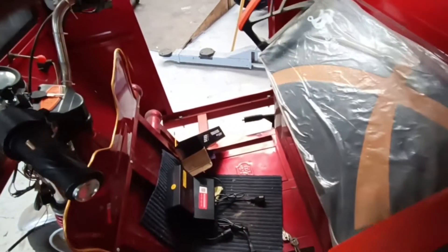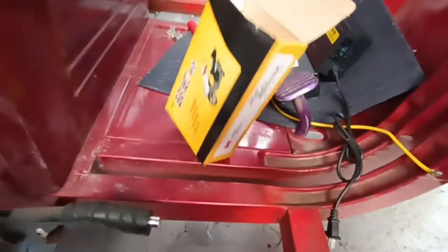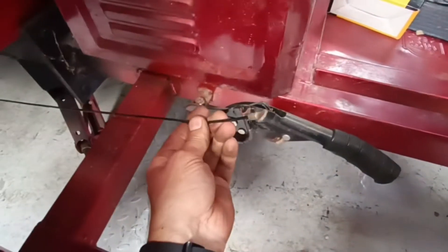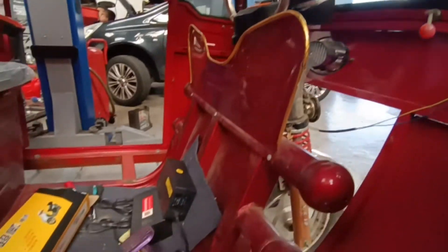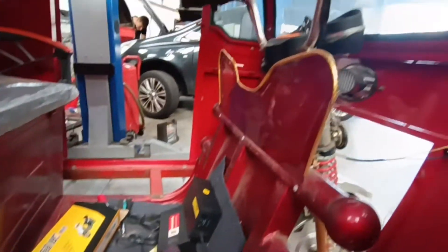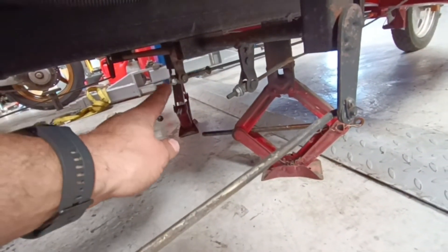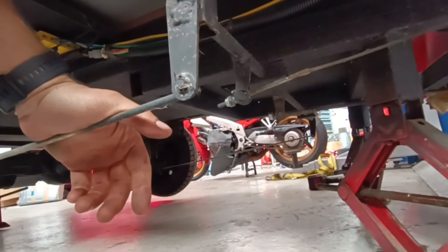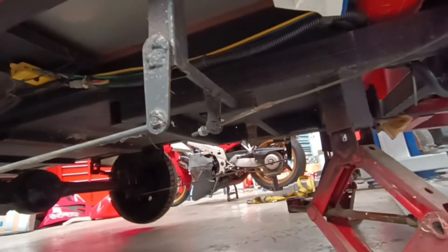Okay, let's close this up. We've been pushing this around — back brake is appalling, handbrake is broken, and the front brake is doing absolutely nothing. It's just going straight to the handlebars. So before we go anywhere I've got to sort these brakes out, so at least I've got one of them working. Okay, here's our handbrake cable, and right next to it is our foot brake cable. If you have a look, you can just about see — it's put on the same bar. There's no backup. There's foot brake or handbrake — they're exactly the same brake. Normally you have a backup on the car which is the handbrake, so if your brakes fail you still have something else to use.